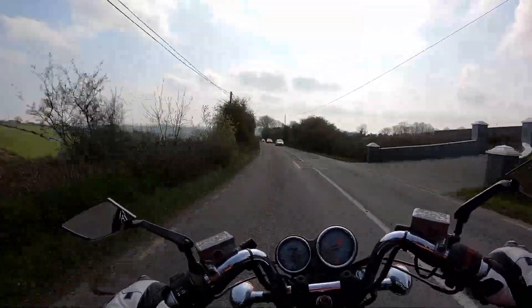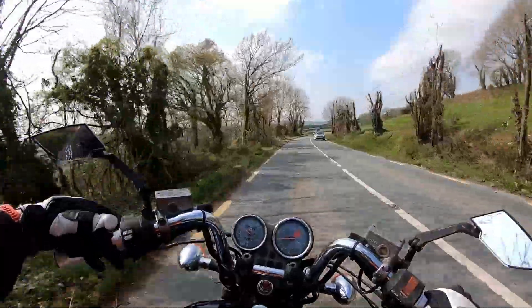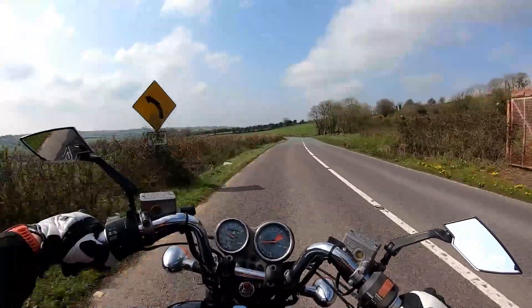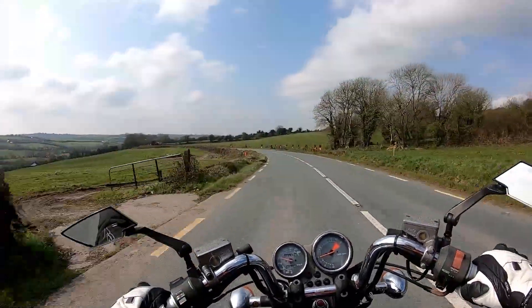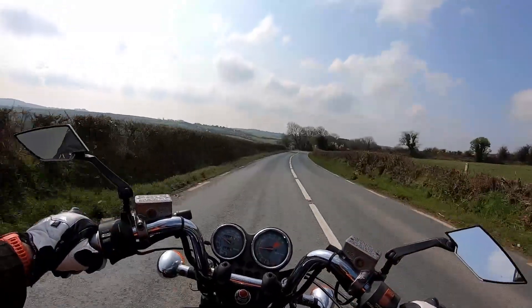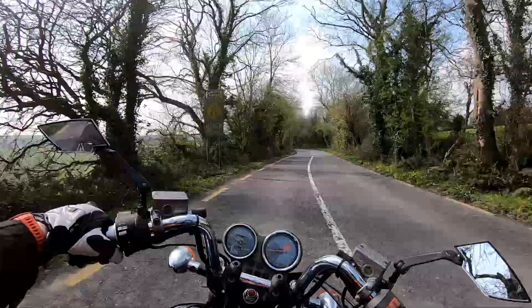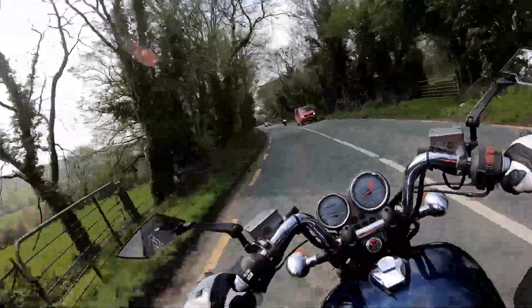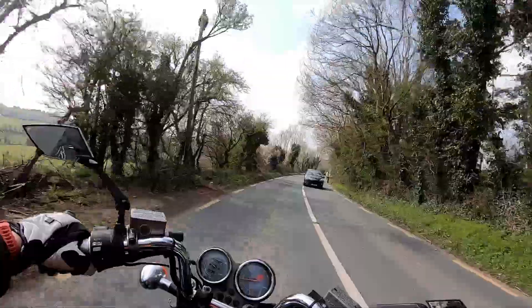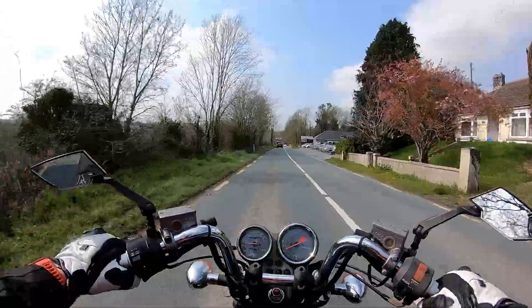My god, it does not disappoint. You might notice there are nice shiny new grips on it. I got this bike on Friday — today is Sunday — and just before I brought it out and made a video I wanted to make sure it was serviceable. It has new grips, new brake pads, and I've checked and topped up the brake and clutch fluids. I'll eventually change them out fully and put a new brake line on it — the rear is a drum so no brake line needed there. There's also a new throttle cable needed; there's a bit of rust here and there, nothing major.